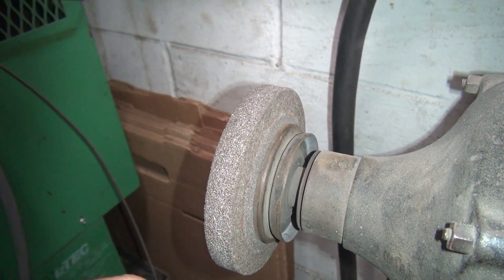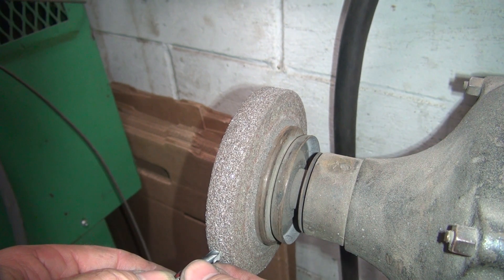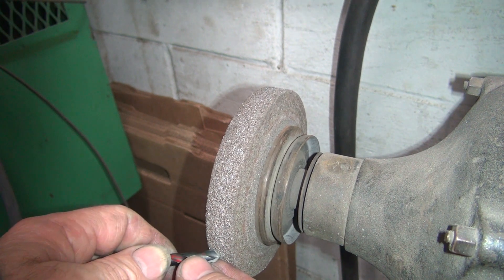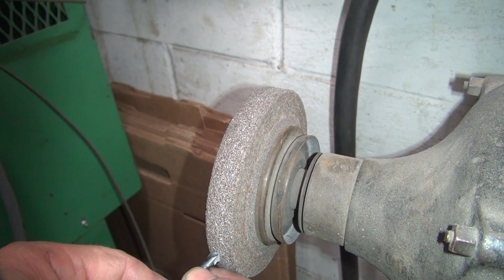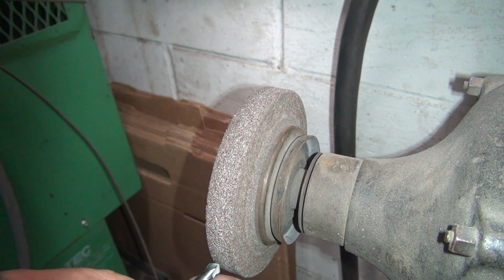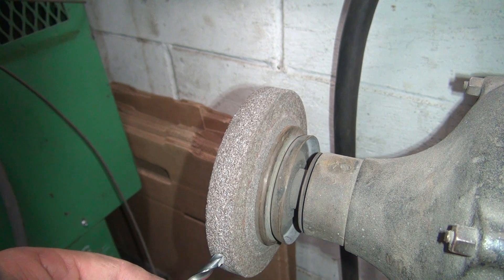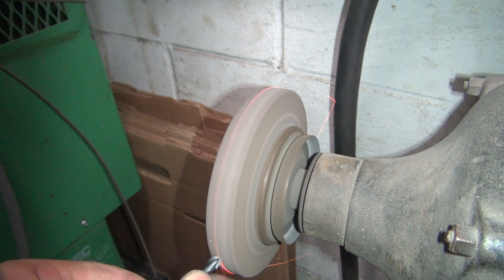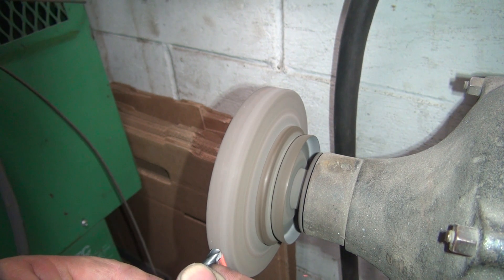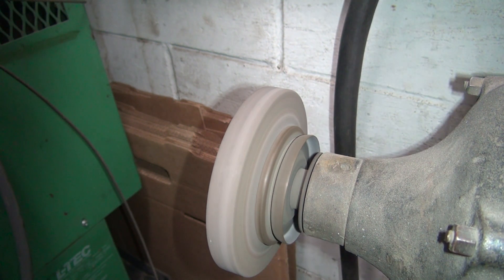So you've got to find out what the cutting edge is — the leading edge. You turn it like this so it's parallel to the surface, you hold it at the angle you want. Ninety degrees doesn't work very good; you need to be flatter, like 130 degrees. Then you want to hold it at a slight pitch so that it doesn't undercut underneath instead of being straight. You also don't want to get it red hot because that'll destroy the temper.